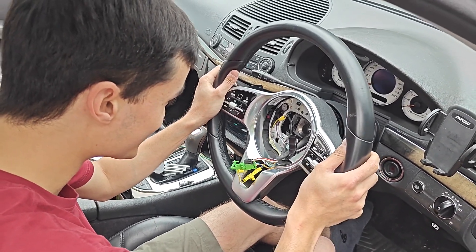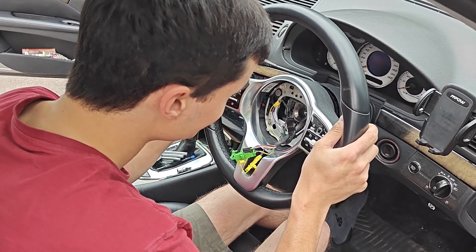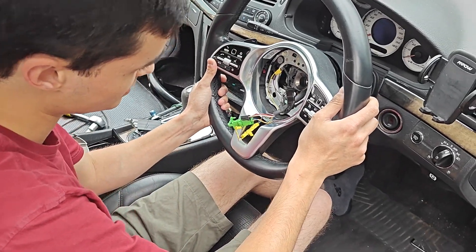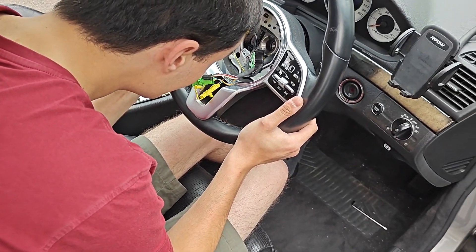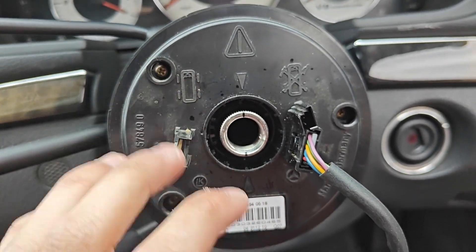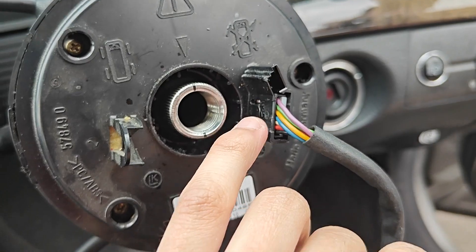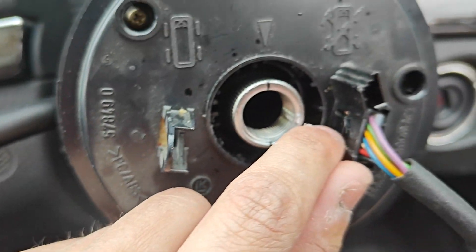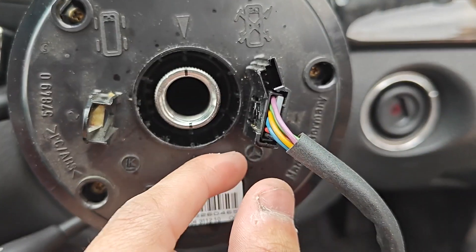No! It's not going on. Let's just quickly do some measurements — I think it might be just hitting a little bit past it. So what we've noticed is that the shaft on the new wheel is the correct diameter, but it's just very, very stiff. If we hit it a bit it does go in, but then it's contacting this little connector here. So I have Alex over there just sanding down this little edge on the wheel, until we eventually make it so that it just passes this piece. You can see there's a little indent where we whacked the wheel on and it hit this, so we just need to file this on and it should fit now.